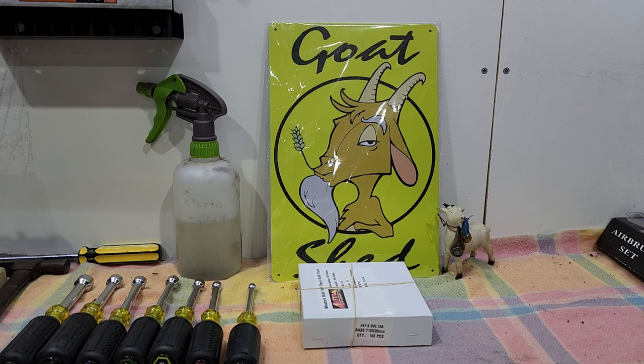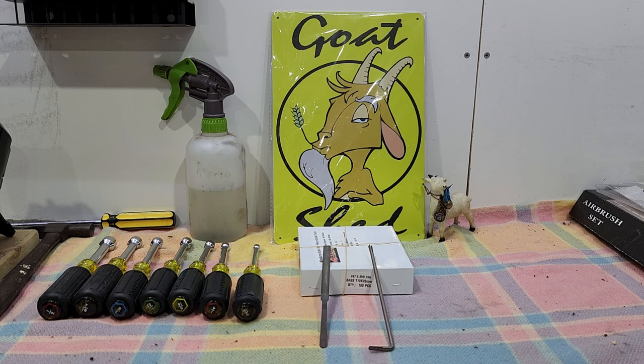You're also going to need a little bit of Singer sewing machine oil — or some people say 3-in-1. I've used Singer-type sewing machine oil for over 50 years in small mechanical devices and it works really well. The other thing you should get is some PBR grease — it's really good stuff, it's dielectric grease. You put that on the rivets of the step units. There are really hardly any other places you need to grease in a pinball machine, but putting it on the steppers reduces friction and wear on the contacts.